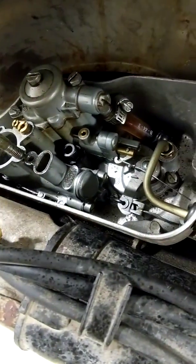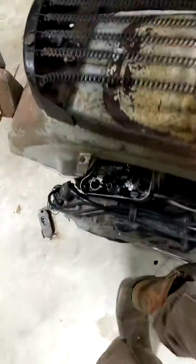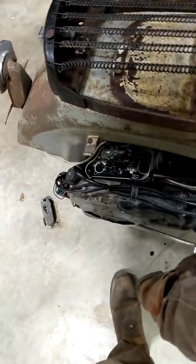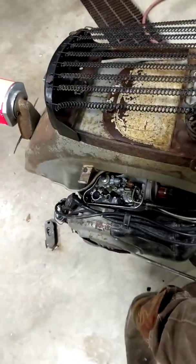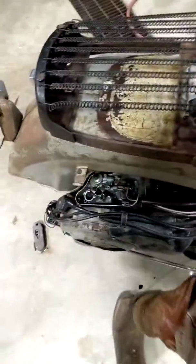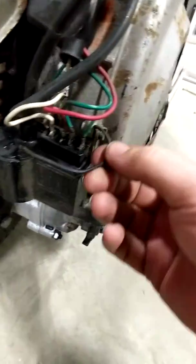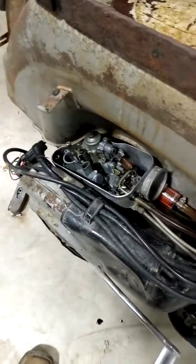All right, just give it a little bit of fuel — nothing. No fuel — nope, it snapped. Just crack it open — nothing. Pull the choke — light open with the choke on. Maybe the magneto's dead, but the thing's brand new. Got some little wires on there, it's got spark, and it's got fuel. It ran good — pulled wheelies first, second, third — until it died.